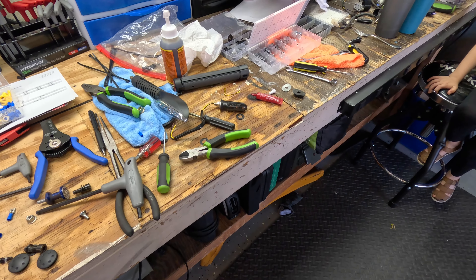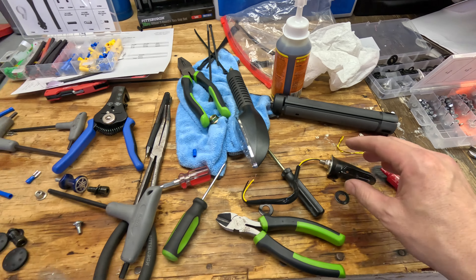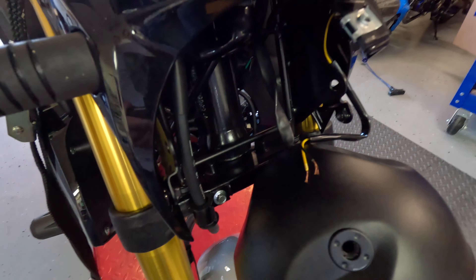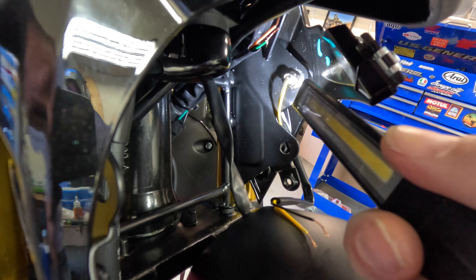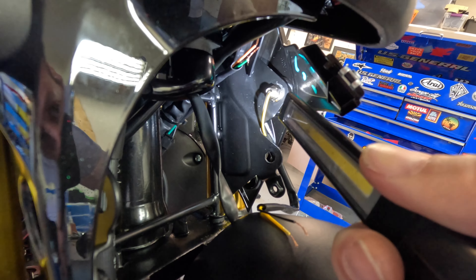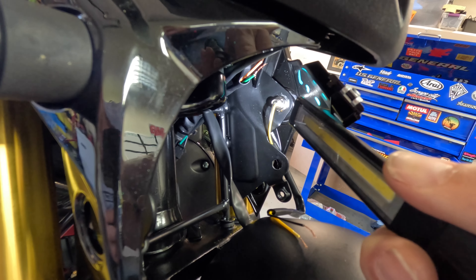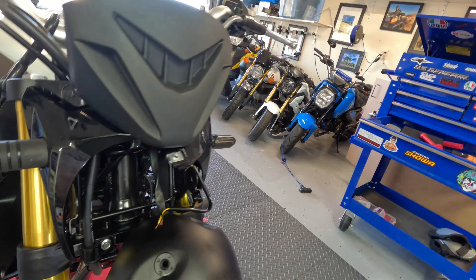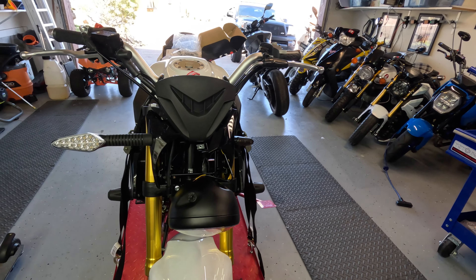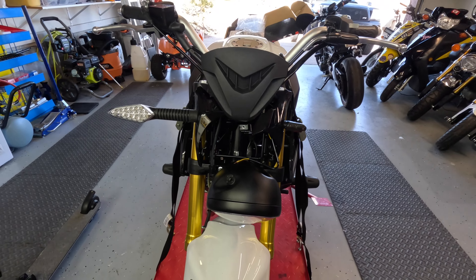You're going to remove this nut, thread it back through your plastic piece which goes into the metal mount right there. I would definitely advise using some kind of Loctite — I'm going to use red Loctite, but blue Loctite would probably work just fine too. That is the majority of getting these switched out — all you have to do then is put everything back together.